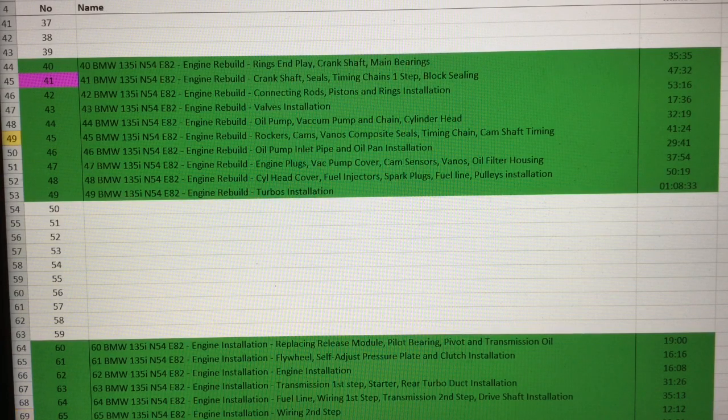I would say also, for the camshafts, the roller drag levers, or the rockers, as I call them very often, you want to take extra care when you install them, because for some reason, I checked all the video footage we've been doing, and I never found out how the one I had tilted sideways. So maybe you want to recheck those, and make sure once everything's installed that all your valve levers are really over the valves and not sideways. I know it sounds stupid, but I have no idea how it happened, so maybe you just want to recheck that before you seal everything.